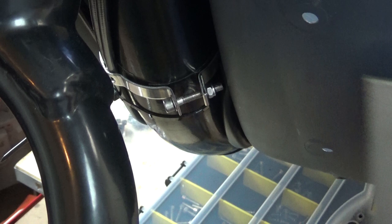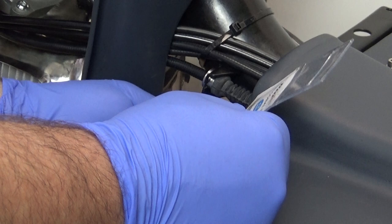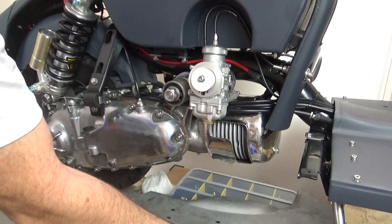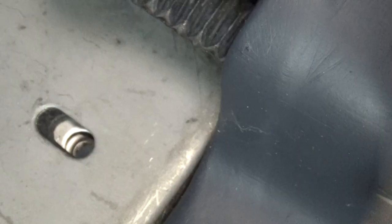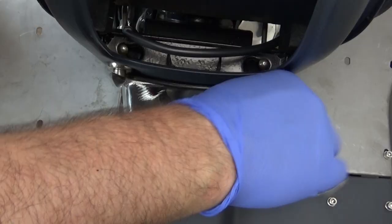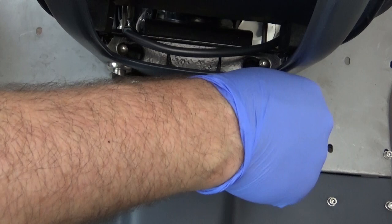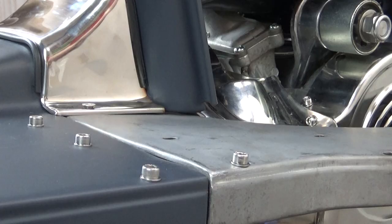Pulling the leg shields off again, I put the strap back on properly and ruminated on the extra work I'd given myself. With that nonsense out of the way, trying to fit something more straightforward — these frame clips from SLUK. These clever little items are going on so I can pull the component I'm about to fit off more reasonably at a later date. I'm sliding them into place using bits of plastic in an attempt at not scratching the frame's powder coat. With them on, it's back on with the floorboards, and now the bridge piece. This one is a stainless item from eBay which doesn't fit at all. Back out with a grinder and a quick skirt to put the curve into the back edge so it fits against the loop correctly. Once I removed quite a bit of metal from the bridge piece and fitted the case of rubbers onto it, it bolted down quite nicely. With it firmly in place, and the leg shields and floorboards bolted down, I can check the gaps and how well it all lines up. I still need to do more work to the leg shield edges — more on that later.